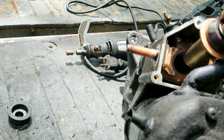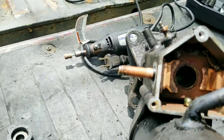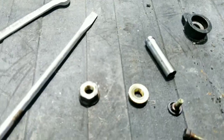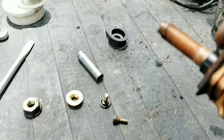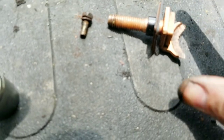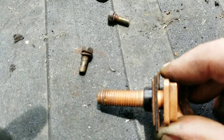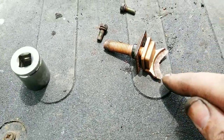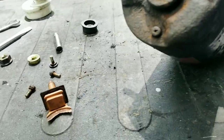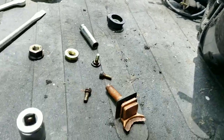There's a little ball bearing in there - make sure you don't lose that. It just sits straight down the hole. You take your two nuts off, this piece comes right out, the plastic comes off, and then you can separate these - it's just pressed in there. You can squeeze it out and buy these for like 15 bucks online for whatever motor you need. Just get the serial number and whatever vehicle you're looking for.